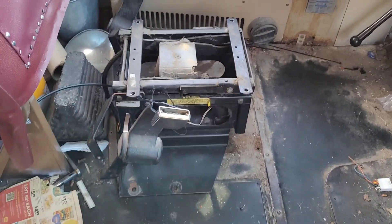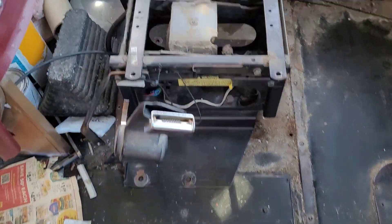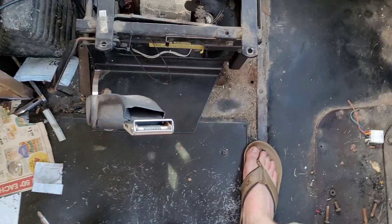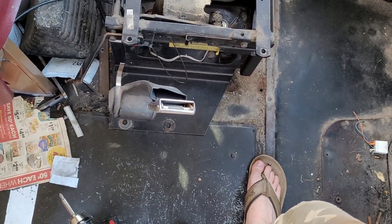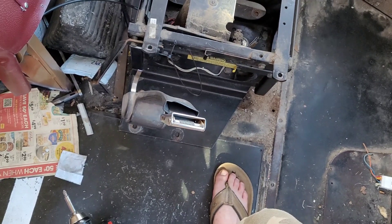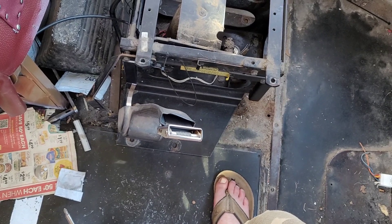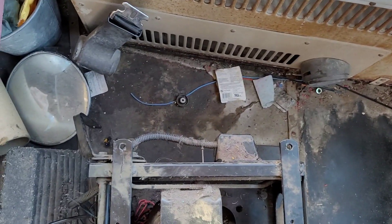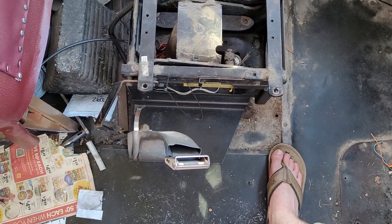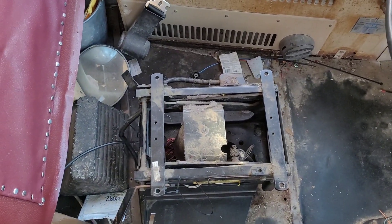The base is in. I've actually pulled the seat off. This has it perfectly centered with the steering wheel. What I'm going to do is go ahead and mount it, and then come back with an angle grinder and cut this excess right here that's hanging over the aisle off. That way we can pull it back out and clean it up. I'm going to drill some new holes so that once we cut this off, we'll just line the holes back up and it'll be good.